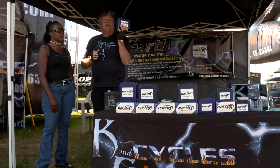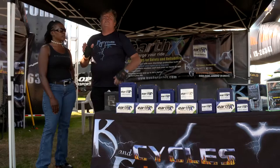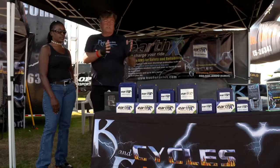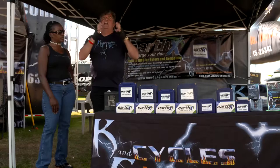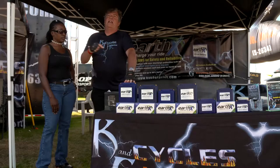You can't overcharge it. You can't undercharge it. This battery does not take any special chargers — you hook it up to a regular trickle charger, battery tender, whatever you normally use for your bike. These batteries come ready to go in the motorcycle. And here's the best part about having a battery management system: if this battery detects an overcharge situation, an undercharge situation, or you try cranking your bike too many times and it isn't going to start, the battery management system will shut down rather than let you run that battery all the way into the ground.